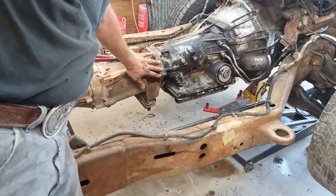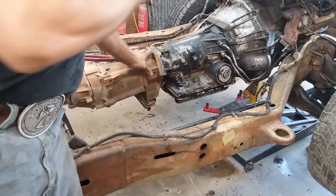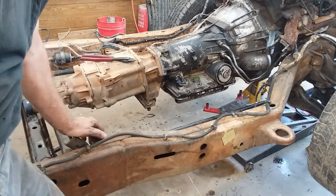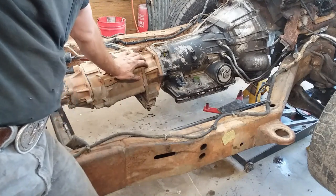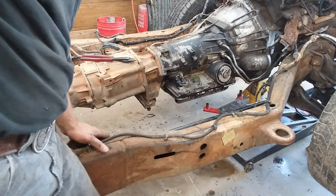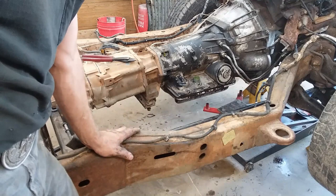We're going to get these loose, take the top two or three out, and leave the bottom corner ones in. Get this back up on the tranny jack, and once it's up on the tranny jack, lower this down out of the way and then we'll be ready to scoot the tranny out. Now, I don't have a transmission jack adapter that fits these — I've basically always crawled up underneath them, left them laying on the crossmember on the back, and just let them kind of come down and hit me in the teeth. They're heavy — probably over 100 pounds — but that's the way I've always done them and I ain't killed myself yet.